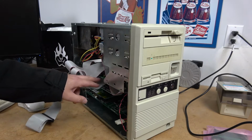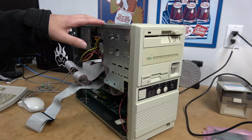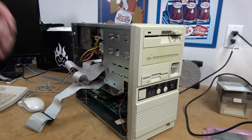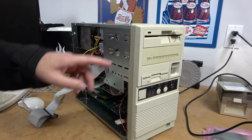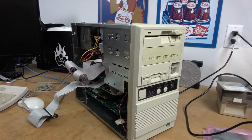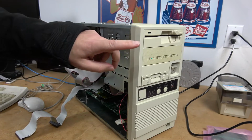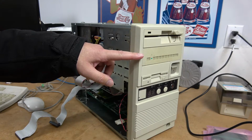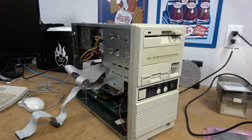Now, according to the Seagate documentation, the RLL controller needs to be set as a secondary controller. That will allow the machine to boot up using the IDE interface so that the BIOS can talk to that controller and allow you to configure hard drives and the floppy drive connection. Then the onboard BIOS on the Seagate controller will take over, find the hard drive, and assign a drive letter to it. Now, if I don't have a hard drive plugged into the 40-pin IDE connection, I can boot off of the Microscience drive. However, with 60 megabytes of space, you quickly run out unless you want to just run DOS programs. I would like to use some DOS stuff for DOS games, and I would also like to be able to install some Windows 3.1, get on the internet, and so on and so forth.